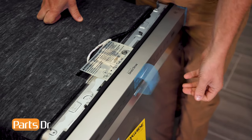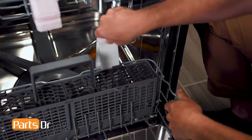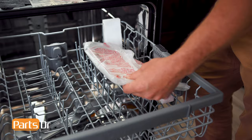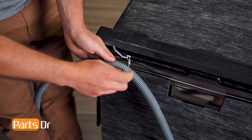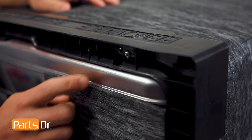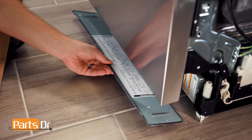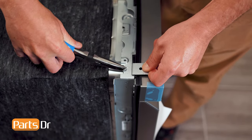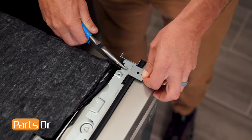With the cabinet ready, it's time to prep the dishwasher. Start by removing the packing materials on the inside and untying the twist tie securing the drain hose. If you need additional clearance for your dishwasher under a lower countertop, you can remove the rear shipping brace. We have plenty of room, so we will leave it. Next, remove the two Phillips screws on the lower cover and remove it. Our countertop is made of wood, so we will use the provided metal installation brackets by inserting into the slot on the upper frame and using pliers to bend and secure in place.